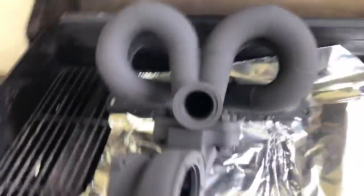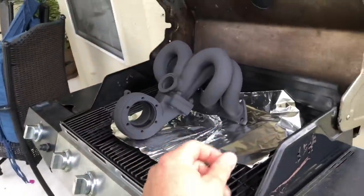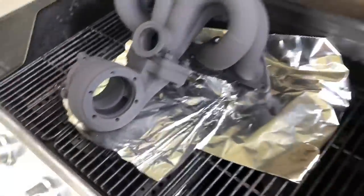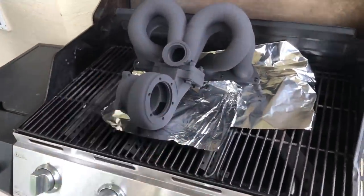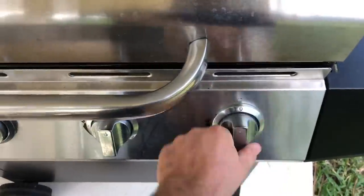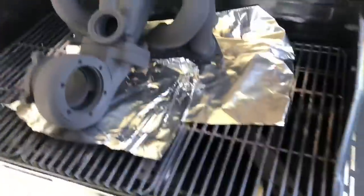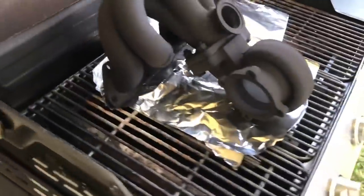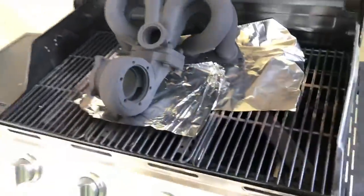It's been 30 minutes, and it is crucial that for this cool down you don't touch it, because any little bit of grease that goes on it right now is going to get burnt into it and you're going to leave a fingerprint. So it's looking really good. I really like the matte finish to it — nice and black and consistent, and it's going to do its job right there. That is the end of the second heat cycle. Still looks like the same flat black. Nothing really changed the way it looks between heat cycles, but she's ready to cool down for 30 minutes, and then the last final heat cycle right after.